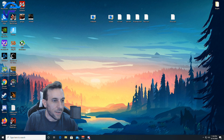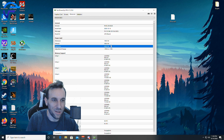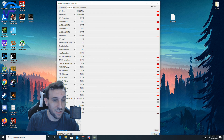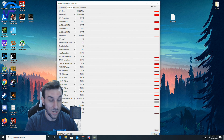Okay, we're back up. Now we'll go to GPU-Z. Check this out — Advanced NVIDIA BIOS 450-watt, baby. And this also fixes the broken power slider on the XC3, so it's definitely worth doing. It doesn't break anything — I've tested this thoroughly, it works fine. The trick is: 8-pin number one and 8-pin number three just mimic each other, so you don't get the full 450 watts, but you get like an extra 50 watts — a decent bump. It's totally worth it, and that's how you do it.